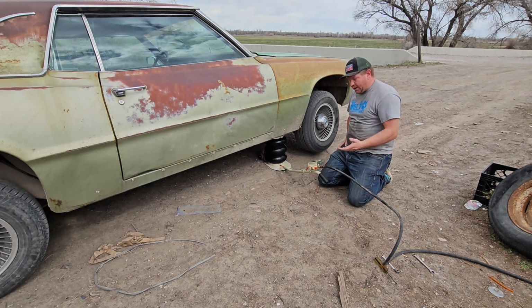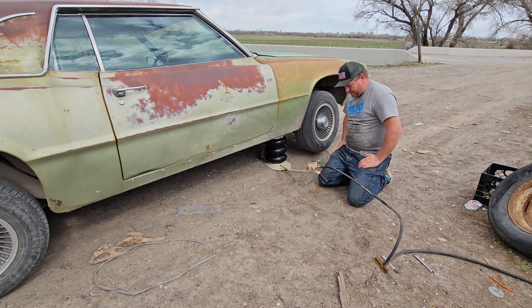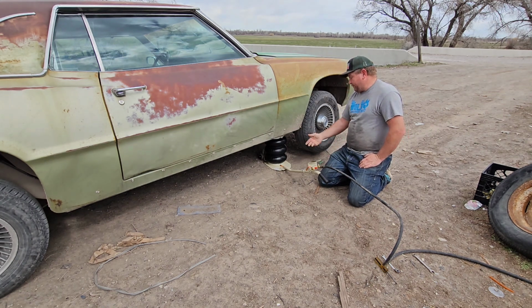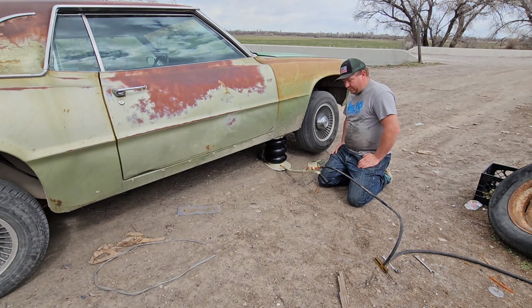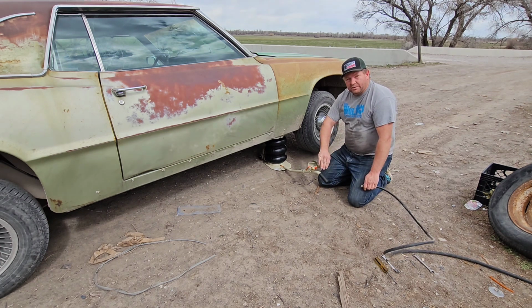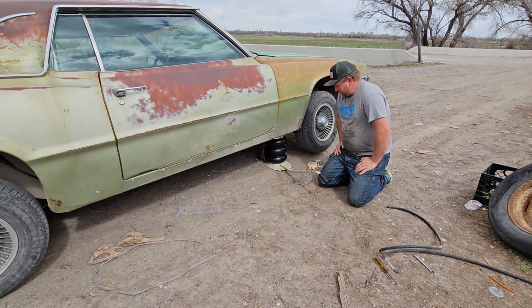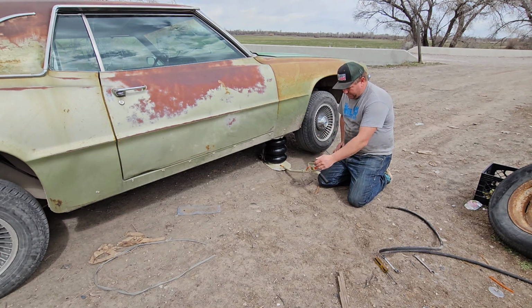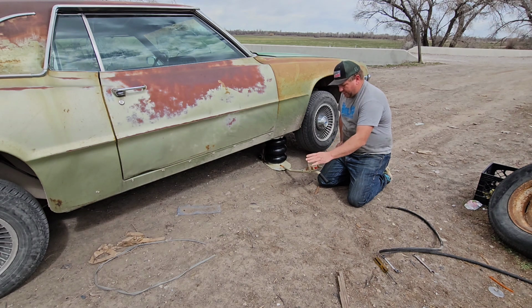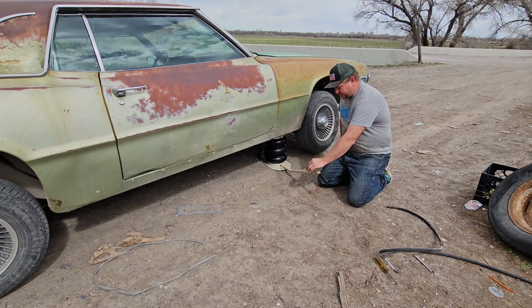Perfect for changing a tire. Like I say, we got onboard air. You can hook this up and use this, probably a lot safer than a scissor jack. Change your tire on there, and if this valve's good, it's not leaking or anything, you can unhook your air and it'll stay right there until you pull your release here. Always go very slow because these things can be touchy until you at least get the hang of it.